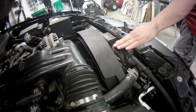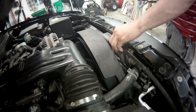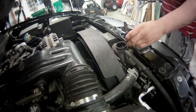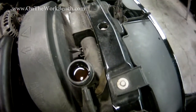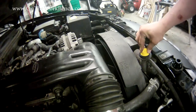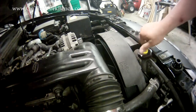At the vehicle, we've got a radiator cap here. Make sure your engine is cold whenever you do this — the engine coolant line is pressurized and you don't want any pressure, which is also why you need safety goggles. Slowly remove the cap because even if it's cold there can still be a little residual pressure in the line. You can see I've got radiator fluid sitting right up at the cap line. With the cap off, we're going to take our plug fitting, set it in here — it should create a nice firm seal — and screw the cap down to make a firm seal and keep everything from leaking out.